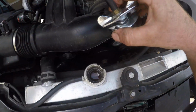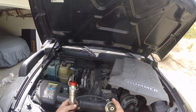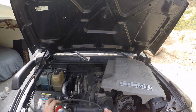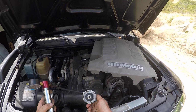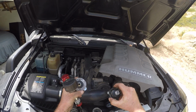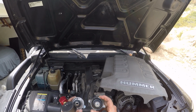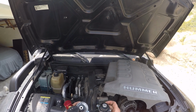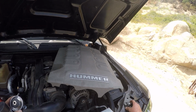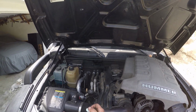So for me, mine's just a little bit low, so I'm going to work with it. Basically, there's a lot of different adapters on these pressure testers. This one happens to be no adapter needed. You're matching it up to the cap here, and this is the same connection with these little wings as this. There's other types that thread in and whatnot. So find your adapter.